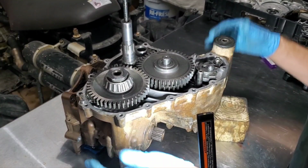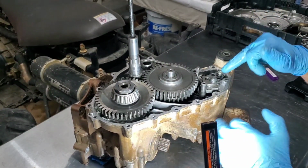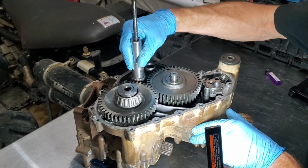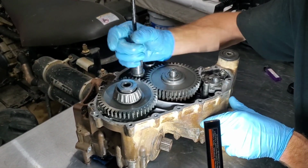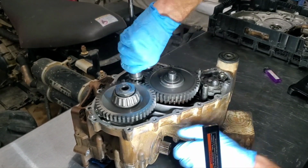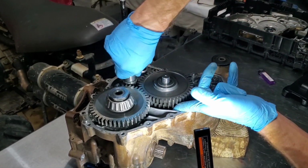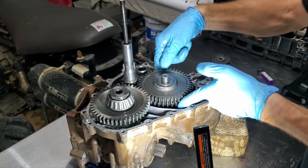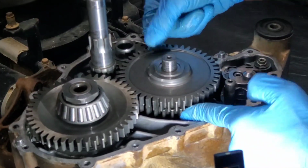All right guys, so I got it sitting on the table, and all I did was take the cover off. Saw a minute ago that this piece was broken. I guess they may have done that when they reassembled it, I don't know. But now that I'm playing with this thing and I've got it in high, it would never go in high. I don't know if you hear that, but it's making a bunch of clanking, and it shouldn't make that noise. And if you see this gear here, I can lift up and spin it and the clanking goes away. But if I put both fingers in here, I can weeble wobble this gear all over the place.